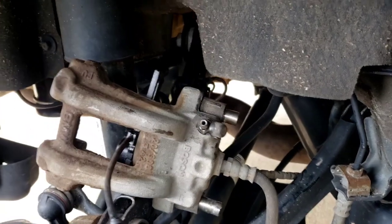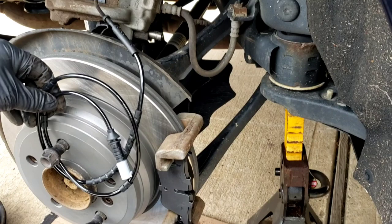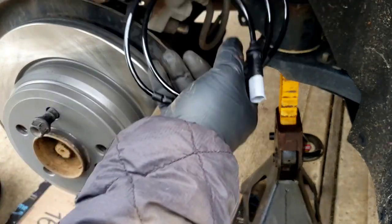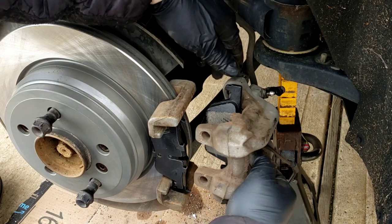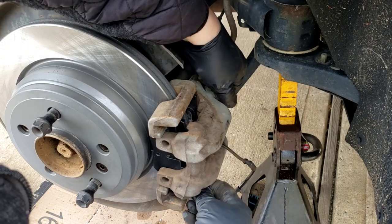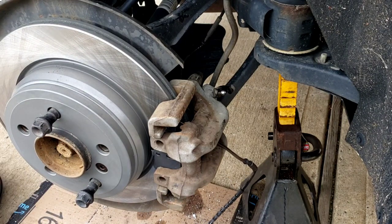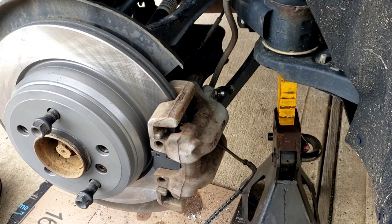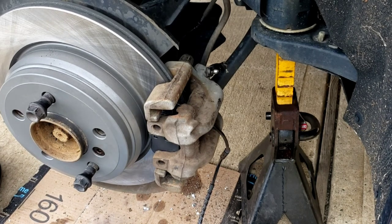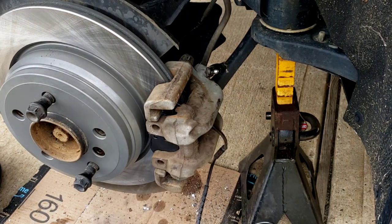Watch out when you're grabbing the caliper — I happen to get a little grease on my fingers when I grab the caliper. It's going to go in here like this. Tighten up the two bolts and run that wire. Put the caliper on, tighten up the eight-millimeter bolts, tighten to specs. Put this little anti-rattle bracket on here — these are always not easy, it's a lot of fun putting this stuff on. Pretty much have to anchor it here, squeeze this in — that one is pretty easy. That just supports the front; otherwise, it'll probably be wobbling.